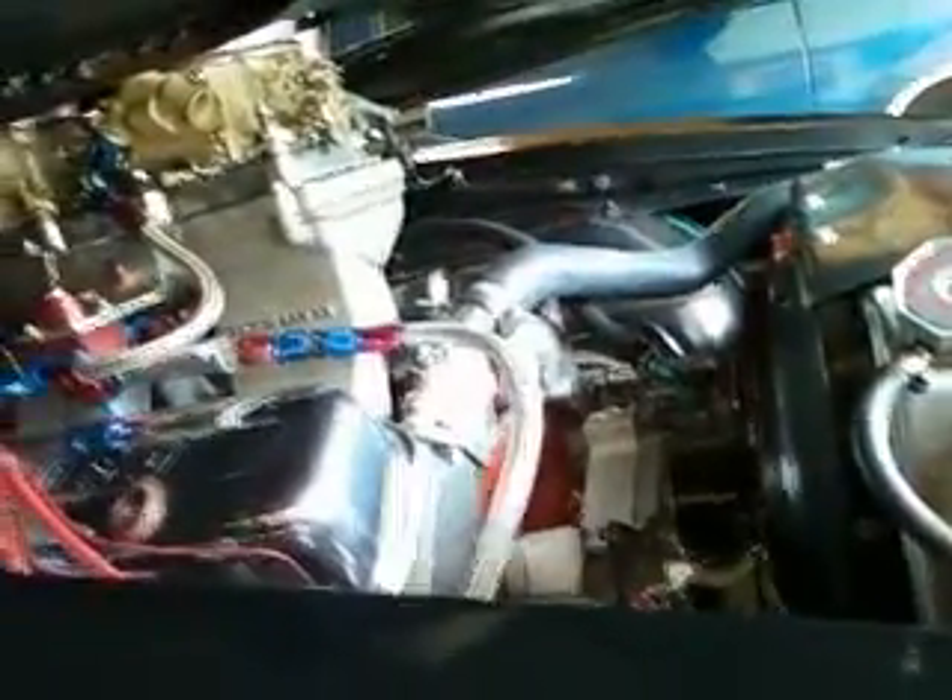I can't guarantee it, of course, but let's put it this way — I pounded this thing on the weekend. It was hot, the engine saw full temperature many times. Unfortunately the upper rad hose blew off and it went to 220 degrees, and it still started no problem. I towed it back and fixed it, but no vapor lock. That's the key — the return line. Don't knock your head against the wall: put a return line in, make sure you've got adequate vent, and try to insulate your lines to some degree. I'm sure that pump is going to work. I can't say for fuel injection though — that's something I'm not overly familiar with. I'm still quite old school that way, but I'm really happy with how the car is going.